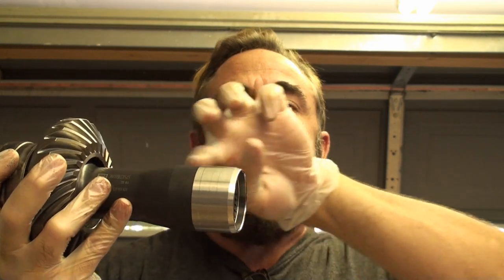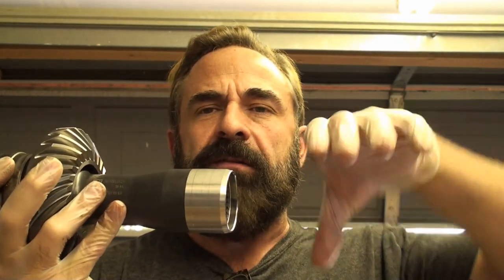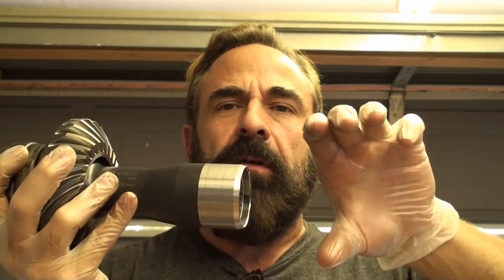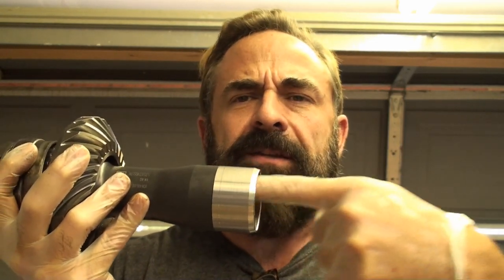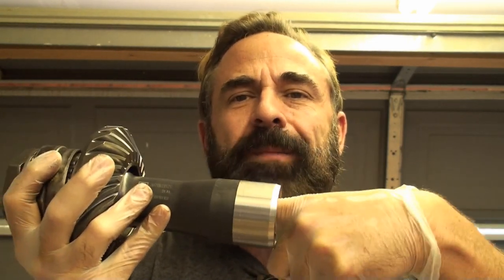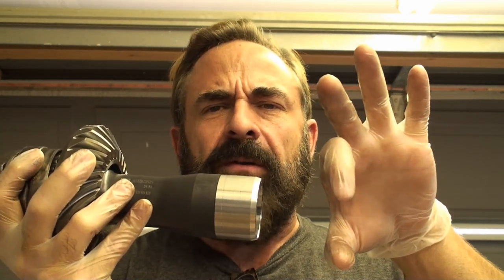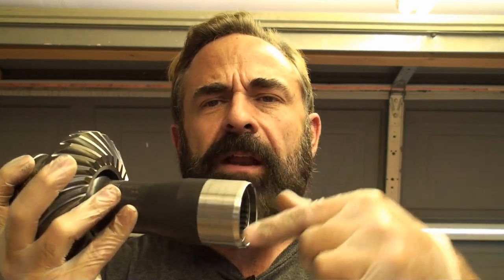And it actually slides all the way through, and it plugs in on this end into the differential and the transmission. And if you're a front wheel drive car, really your differential only has to connect through your spider gears into this shaft that would be going through here and just turn this wheel. But on the all wheel drive models, the outside of the differential on the housing has teeth on it, has splines on it, and they plug into this.